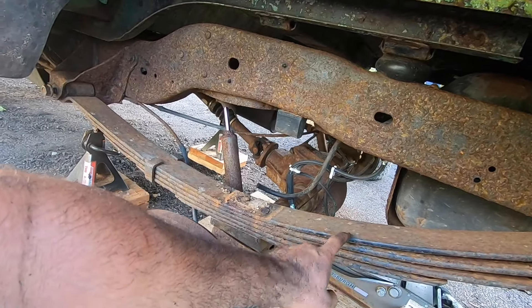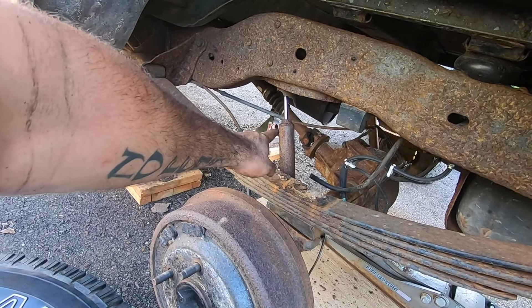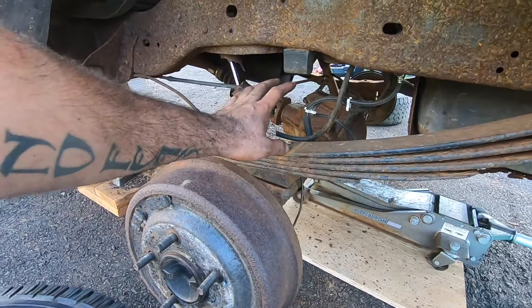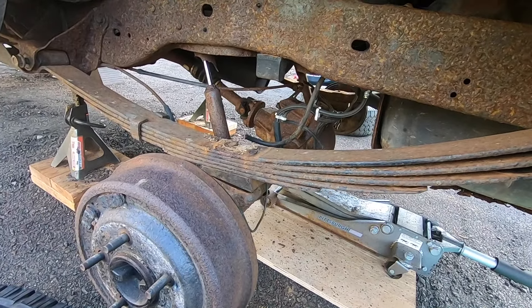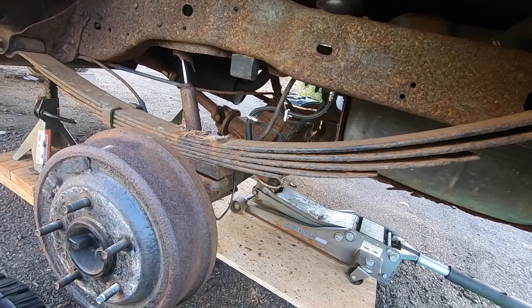The back is pretty straightforward once you get the new leaf spring in and swap the shocks. The reason I didn't take the shocks out first is I wanted them to stabilize the rear end — I don't have a second pair of jack stands, just the jack holding it up. So I'll do one side at a time so the thing isn't wobbling all over the place. I'm real excited to get this on. I gotta pick up the tires at work tomorrow, so we'll probably have the new tires on and the lift done then.